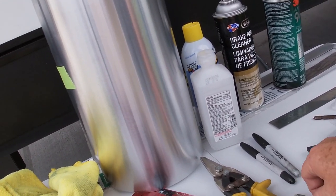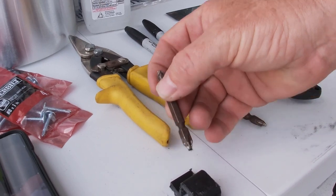I found a video on YouTube about replacing a section of the wear bar on each end of the slide by cutting a section out and installing rollers that Lippert makes — they have an angle bracket and you bolt them in place. But I ran into a problem: the height of the wear bar measured from the table to the top is three-quarters of an inch, while the replacement rollers are an inch and an eighth tall. That makes quite a bit of difference, and I didn't want a big gap at the front of the slide when it's all the way out.